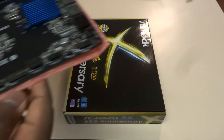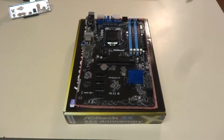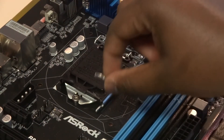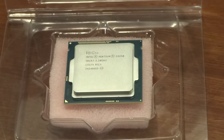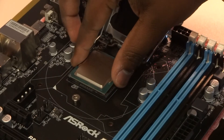The first step to building your PC is to install the CPU. Find the CPU socket in the top center of your motherboard — you'll see a cover and a latch next to it. To install the CPU, push down the latch and push it out to release the cover, exposing the pins on the motherboard. Find the little triangle on the bottom corner of your CPU and match it up with the triangle on the motherboard to get the proper orientation, then slowly and gently slide it into the socket.